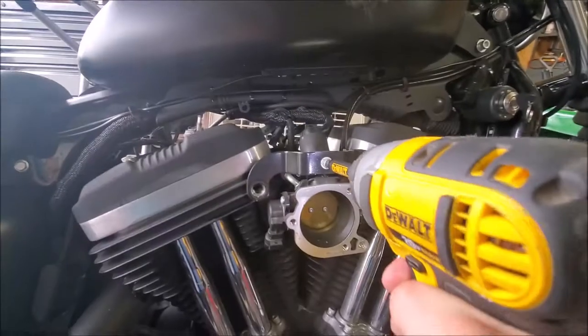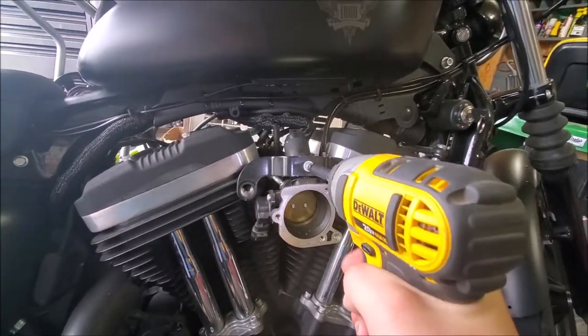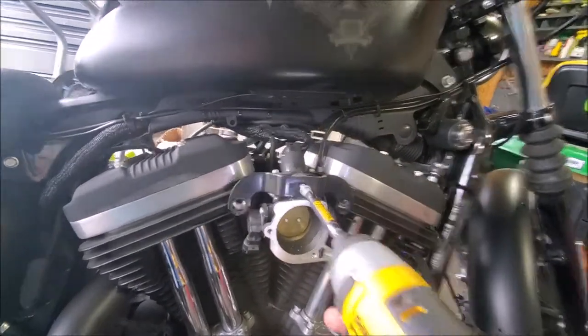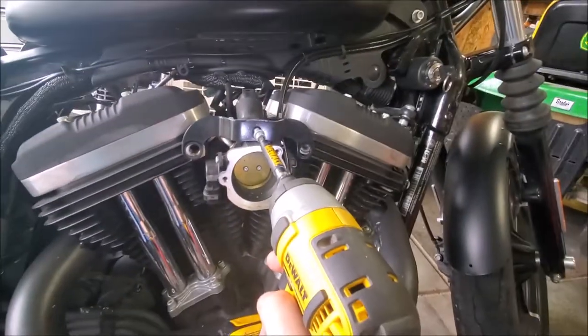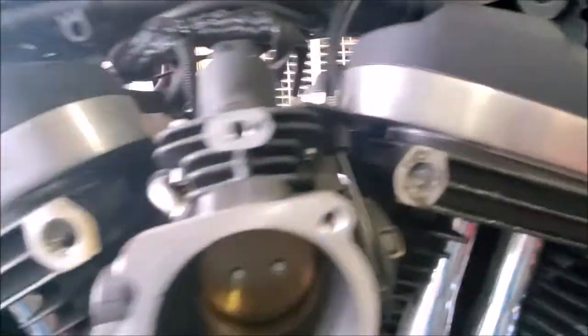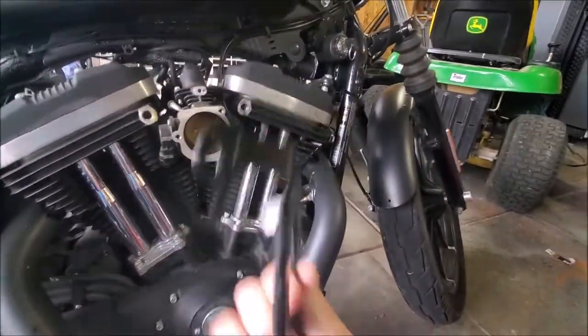All right, pull this one. And that's going to be Loctited in, so a little hard to get out, but it comes out. So your first step is just take a rag or something and clean out both these holes, the junk off of it. Then once we get both those clean, we will throw the new bracket up, which is this, with the gasket on the back.